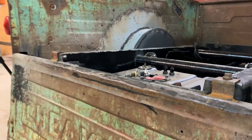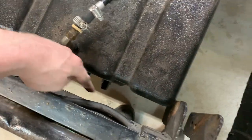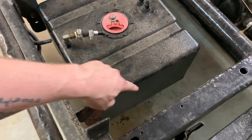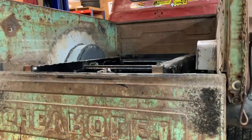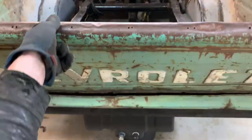You can see the fuel vent is the highest part right now and it's not up near the bottom of the frame at all — so it's not going to be near the floor. My feed is going to be back here and I'll turn that so it goes up, and here's my return. I am running dual pumps, so I'll be using two of these feeds — one will go this way, one will go around that way, and the pumps will be situated up here somewhere. It's going to be great!